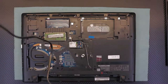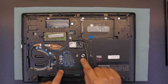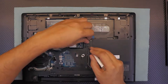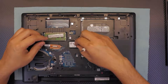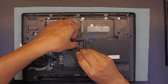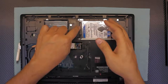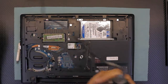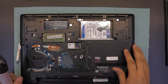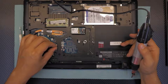Put the CD-ROM in face down and add the screw in the middle before you forget. Put the three screws for the keyboard back in. Then grab the Wi-Fi cables, run them in, and use tweezers to connect them — hold them in position and push down. For the hard drive, put the end side down and slide it toward the connectors, then put in the four screws.